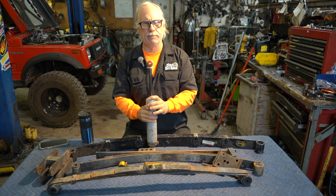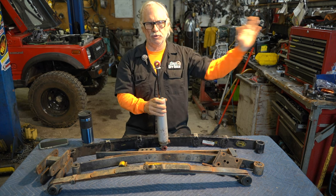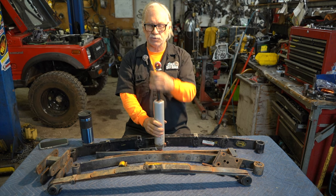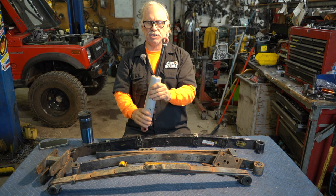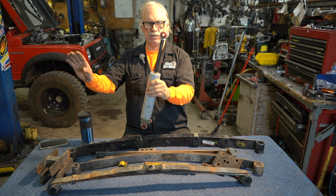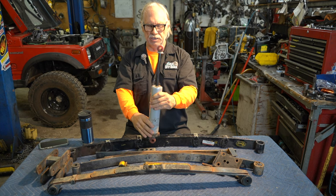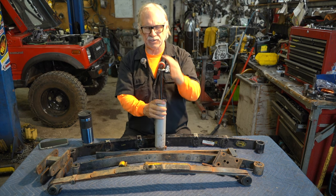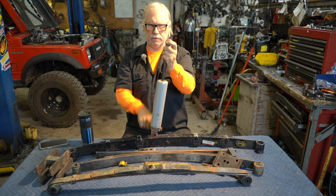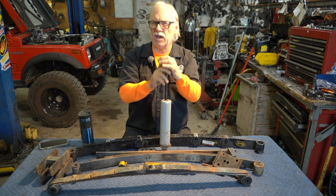This brings me to a story: with Gazooks, after finishing the ultimate YJ system on a Friday, there was a wheeling trip Saturday. I ran to Napa and bought the longest shocks I could find. I almost killed myself and my father-in-law several times going 65-70 down the freeway — the front tire would hit a pothole and the body would sway badly because I had YJ springs but no strong enough shock to stop the spring flex. For YJs you need a very stiff shock that you cannot push in easily — not a cheap spongy shock. For the front shock, I tilt them back about an inch and a half so that when the axle droops, the shock is straight up and down, working at full efficiency.